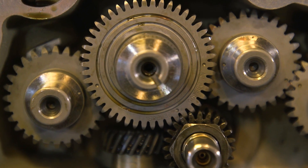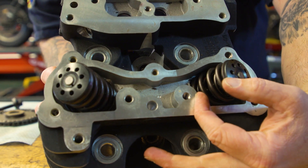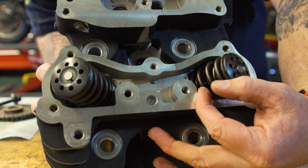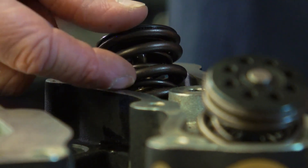Valve lift is directly proportional to what kind of valve springs you have in your engine. If you're putting a cam in a stock engine, generally you don't want to go with a very large cam anyway because those motors aren't built to take full advantage of high lift cams. But the biggest thing is make sure you have a valve spring that's set up for the lift of your cam. Most cam companies will note whether it works with stock valve springs or needs high lift valve springs — otherwise you run into coil bind, meaning that spring gets all smashed down and it won't work.